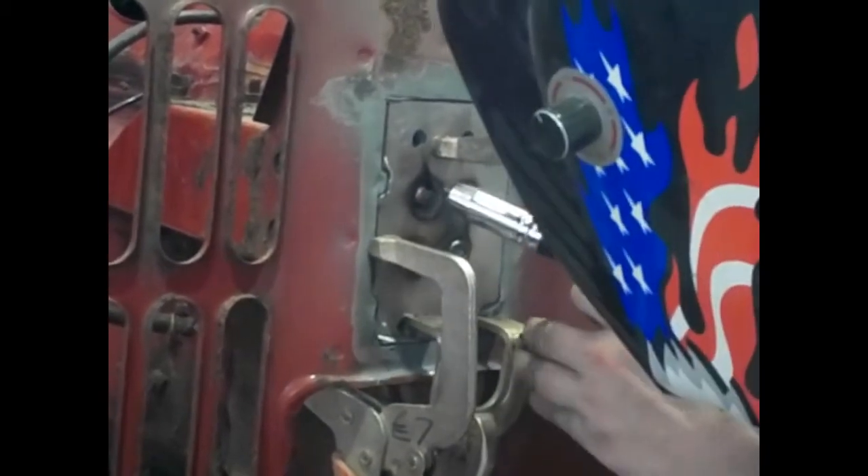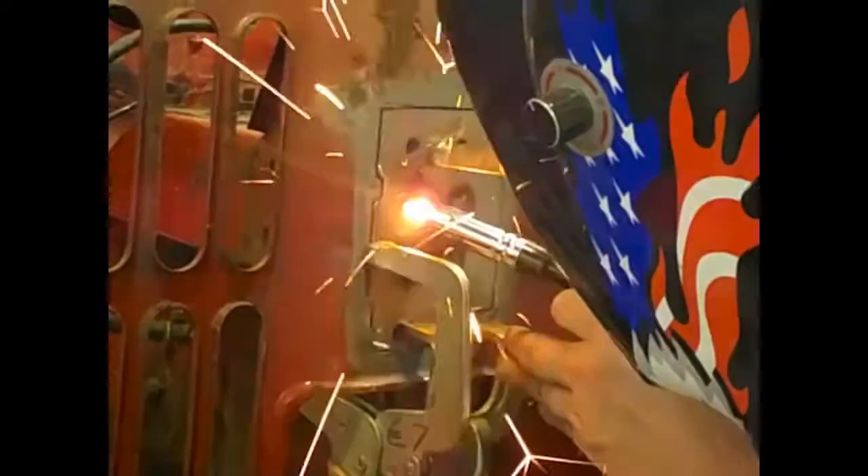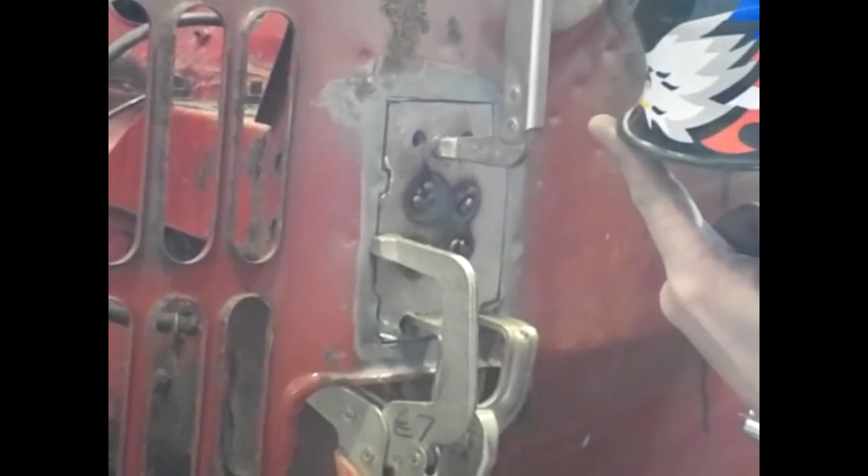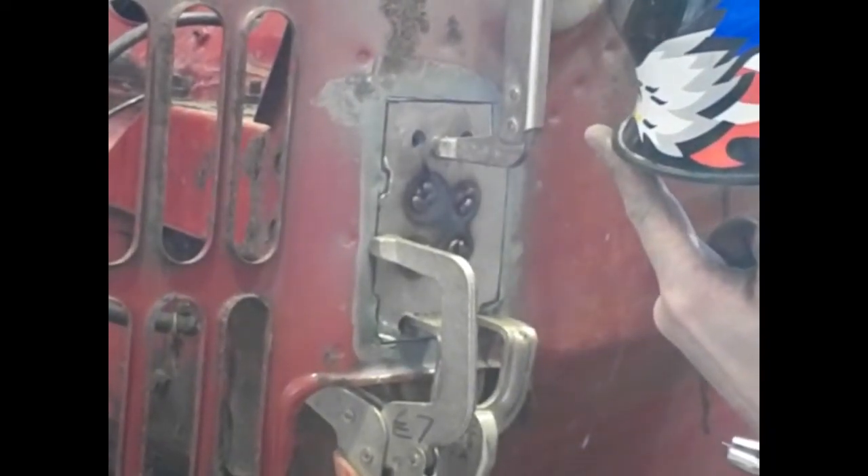As you can see when I did the plug welds I didn't quite fill all of the holes, so I just went over it again quickly. Doesn't really matter as long as it's secure — by the time you've got the bracket for the shock absorber on you won't see it anyway, but I just like to be thorough and make sure you've filled in all the gaps.